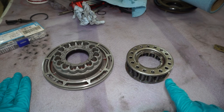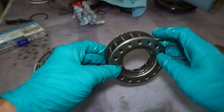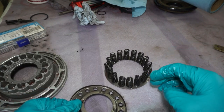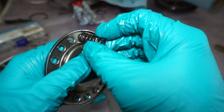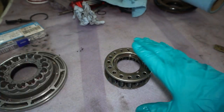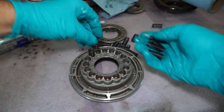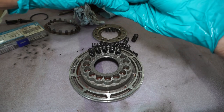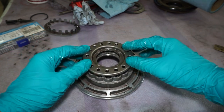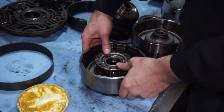The Extreme Automatic kit does come with a different spring pack for the direct drum. Your spring pack looks like this little sandwich plate here — use a flathead and pry that bottom section away, then you can separate the springs from the top disc. If you're doing a stock piston with the replacement springs, you can just put it back together like this — the springs will clip in where they need to go. On this transmission we actually did an aluminum piston with a six-clutch direct. So just take your new springs, put them in like this, use your factory plate and go over the top, make sure the springs are centered on the little holes, then press it on like normal. I'll go ahead and put the springs on — take the spring assembly over to the press, put it over the piston, press it down, and put the snap ring on.